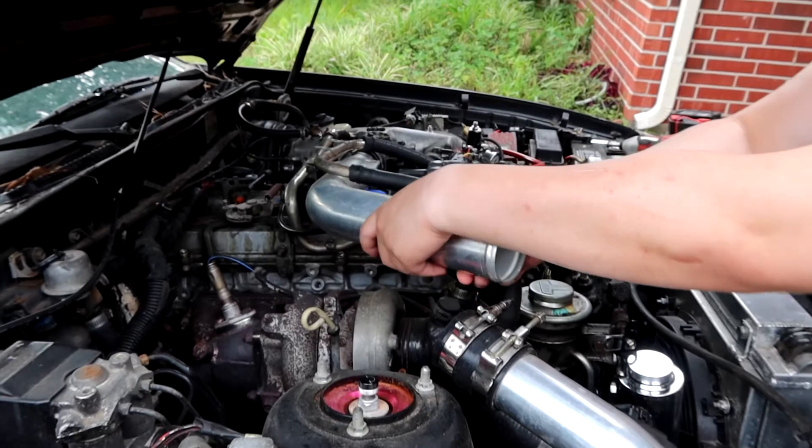This is greasy. Look at all that oil. I don't know if that's a PCV issue or if the turbo seals are blown. Not good either way. A lot of oil residue in the turbo - not a happy turbo. Tons of blow-by or the seals are gone. Let's check the shaft play. Oh yeah, you can hear it. That is bad. You can hear that thing. Turbo's gone.